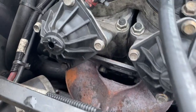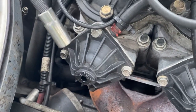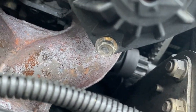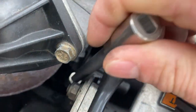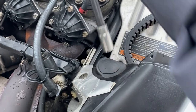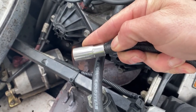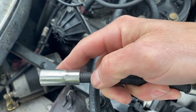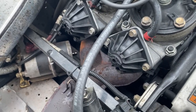As for the flex shaft, I think it's nine inches long but don't quote me on that. The starter is right here — you have to go in between, it's going to be very tight. The other end goes directly to that clutch right here. You can see the little gear on that side — there are no screws or anything, you just slide it in, bend and align the shaft of your starter, clip it, and the counter-flex of the flex shaft will keep it in position.